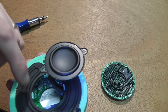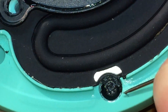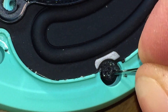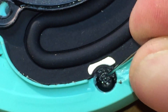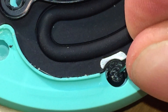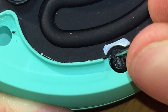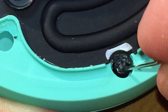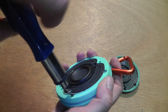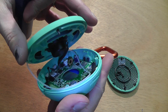In this close-up you can see that on the screws they have a clear paint inside the thread, probably just to keep water out. You can't really get in through the slots with a screwdriver, so you first have to use a safety pin to get some of that paint out so you can open them. I'm removing the last of those four screws here.